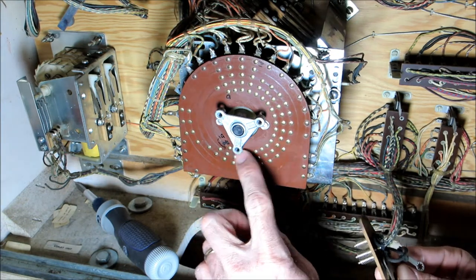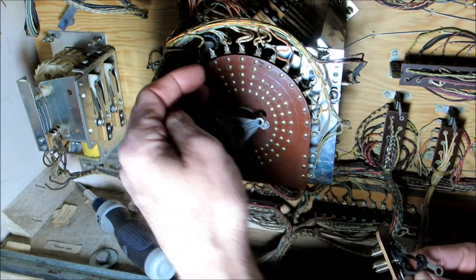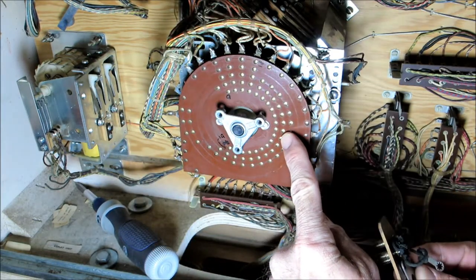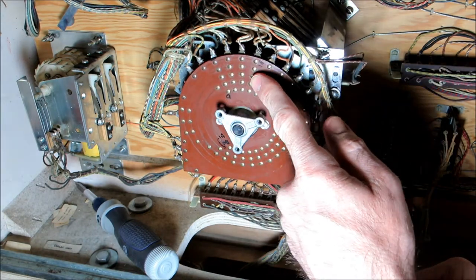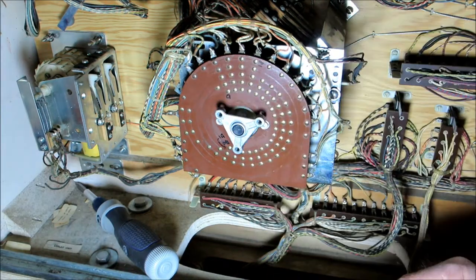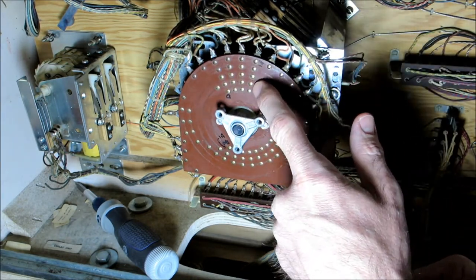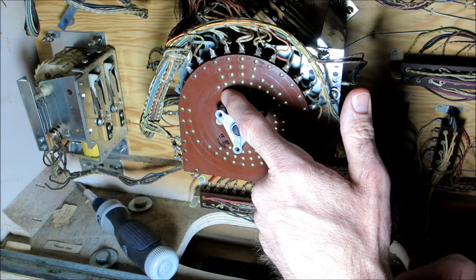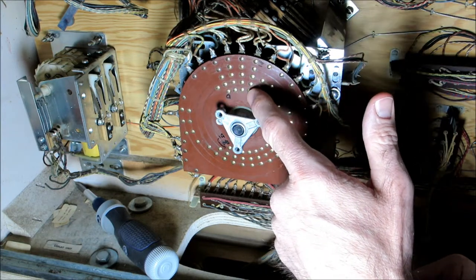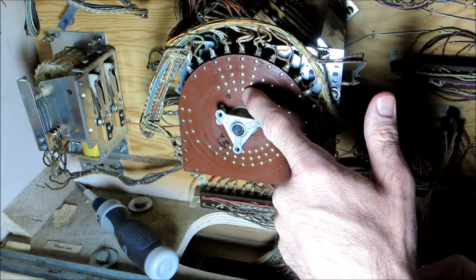And again, the inner ring controls the ball in play light. The next 2 are that double wiper connection, and they control the score, the functionality that if you hit a certain score, you win points. And those repeat every 5th one. So the first pair are for player 1, and then player 2, player 3, player 4, and then it repeats. It's going to be player 1 again because it's ball 2. So kind of a good way to think about this is on the lights, 0, 1, 2, and 3 will all be wired together. They're all shorted together because those are ball in play 1.